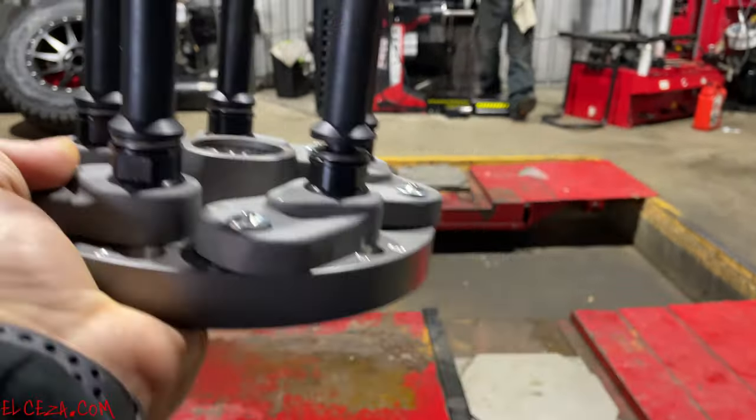In the middle, where the dot is, as close as you can get it. This way, okay? The reason they've done that is when we had that long laser across it, what was in the way when you went to put your weights in? Your hand. Yeah. Now the laser points over the top of it and you can manipulate your hand around to get to where that laser is right where it needs to be. You can put that weight on it, okay?